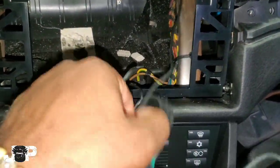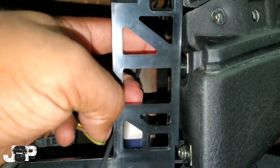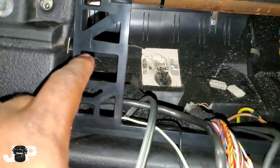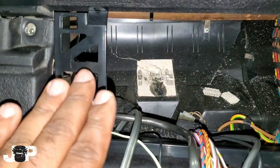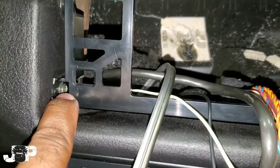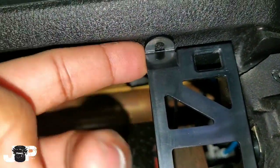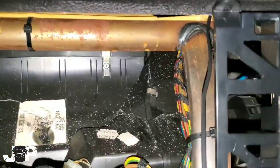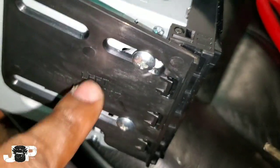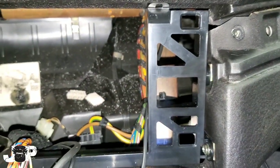This is just the wire harnesses and the GPS antenna — don't mind that, I'll clean all this up. The dash kit comes with this bracket. You remember where we had to take the screws off the top and bottom on the left and right sides? This black piece is going to go in that place using the same factory screws. Once you put the bracket on the side of the radio, it has little tabs that click inside here, and there'll be a cover piece with white clips that goes inside there as well.